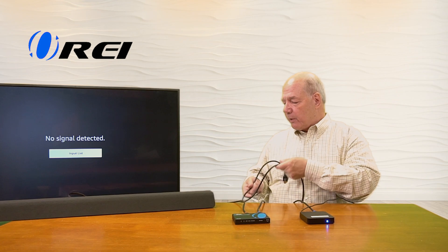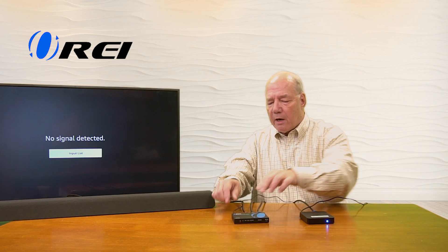I've got another high-speed HDMI cable connected to the soundbar, which is in HDMI ARC mode, and I'll plug that into the HDMI output. Now I can add power — the power supply is already plugged in and the barrel connection goes into the extractor. The minute I add power, it starts an internal power-on self-test checking the electronics, the media stream, the output soundbar, and the monitor. Once it finishes, you'll see the media displayed and the sound through the soundbar — it takes a moment for the HDMI ARC handshake to complete.